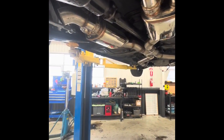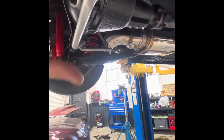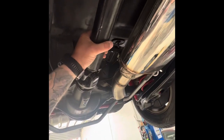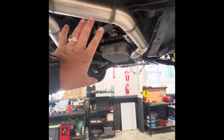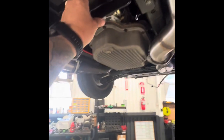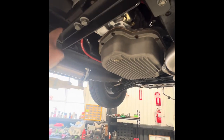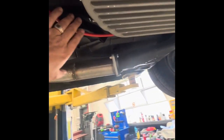All right, so that's pretty much it. The whole rear end is all done. Tail shaft's in, diffs have all been redone. 3.7s, fully rebuilt LSD. The tail shaft was out of the Statesman, but that's been shortened and installed. Exhaust is all done. Underbody car spray has all been done. Moving forward, obviously a bit of an aftermarket job here as a support for the box. That's all welded up and done. Box has all been wired up. That's all connected. Turbo 400 done.